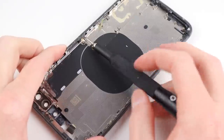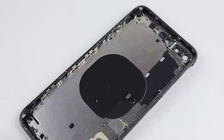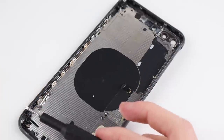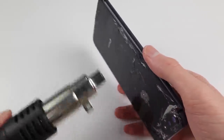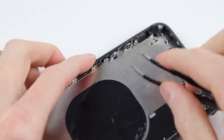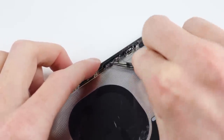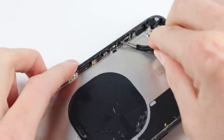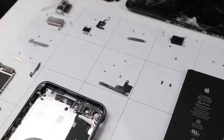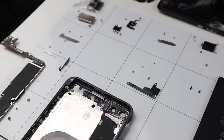With that removed, I can move along to a few of these brackets which are located on the side of the iPhone 8 housing. These brackets are clips for the display to attach to the iPhone. After that, I can use a heat gun to heat the back of the iPhone so I can remove the wireless charging coil. Lastly, I can remove these little metal clips from the back of the volume and power buttons. With that now done, the iPhone is completely empty and we have an abundance of parts on my desk, so it's time to reassemble this iPhone with a new housing.